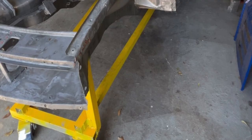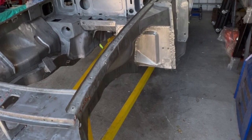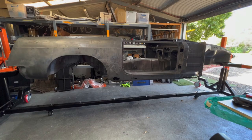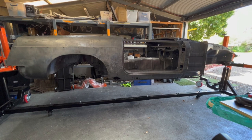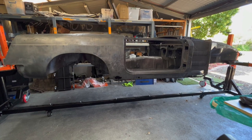This segment sees the return of the body shell, which sounds like something of a horror story — and if you have a look at the body and the rust, it actually is. Task one is to mount it up on our car shell rotisserie, which allows us to rotate the car around its axis and makes working on the bottom side, the sills and things a much easier proposition by putting those areas in a more accessible location.